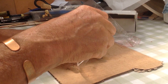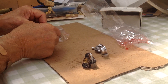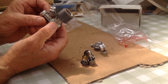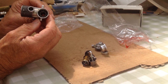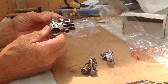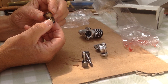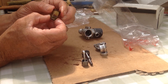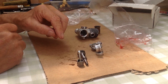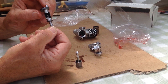Can I even open the bags? It's only me that is unable to open the zipper bag — it's well oiled, look, like me! Here we have the Para Wasp crankcase, Venturi needle valve, roller bearing in the front, roller bearing in the back. That's the crankcase — beautiful job, number 64, made in Europe, remember that. Brass chromed liner, super-B, made with Schnuerle porting. Look at that crankshaft, baby, and the size of that port — counterbalance crank.